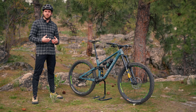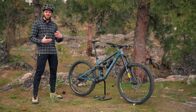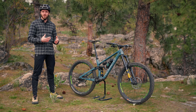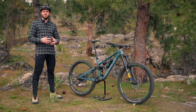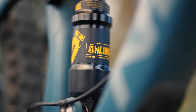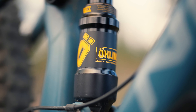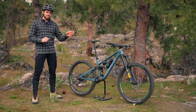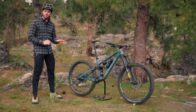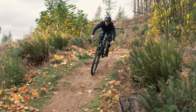It has a nice supple feel with good ramp-up but is also lively. When I had the X2 on this bike it felt kind of plain Jane — dead, not super playful. This feels more like the RockShox feeling out back: super playful, but when it comes to damping it's super smooth. For low-speed compression I'm running 10 clicks out from fully closed — there are 16 options and I found that unlike the fork, every two clicks I could really feel the difference on the trail. The TTX2 Air offers seven clicks of low-speed rebound control.